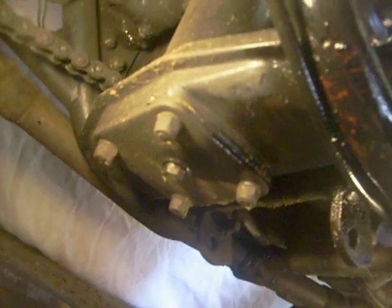Oh, look underneath. Alright, you see quite a bit of oil. It's all running. So, it's definitely from this area. And the bit to suspect are them pipes up there. Now, that looks alright and dry. Let's get a light. Yeah, that looks quite dry. So it's them two pipes I'm going to be changing there.